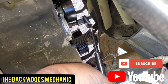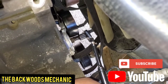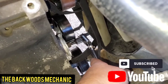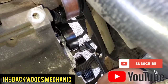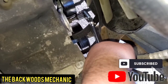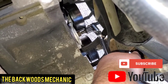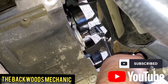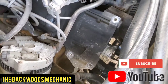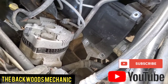There are a few dozen different ways you can change these - hopefully this method will help you. If you do not have a torque wrench, just make sure that you tighten it up good and tight - you don't want to over-tighten it and risk breaking it. If you tighten it up nice and snug, make sure it's with a three-eighths drive ratchet such as this one. If I put a big half-inch drive on here to try to torque it, I'm liable to put way too much torque and damage or break it. Once you get that all torqued down and snugged up, you work your way back to plug in your alternator the same way you took it apart, then it's time to put the belt on.